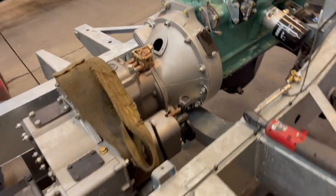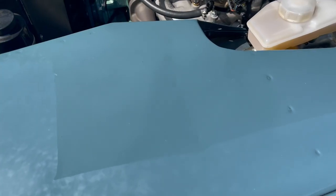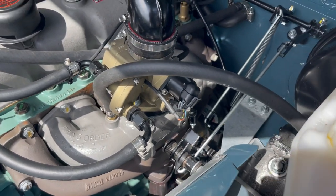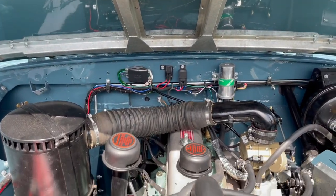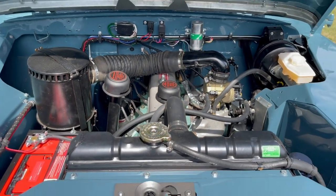We correct the problems on these Series 2As not by reinventing the wheel and putting in completely out-of-place drivetrains. We just take Series 3 parts and fit them to the Series 2A, or Defender parts — parts that Land Rover already improved. There are some cases where we need to use completely modern parts, like electronic fuel injection. 10% ethanol gasoline did not exist when these vehicles were in use, so now it's really a necessity to add electronic fuel injection to make them run properly.